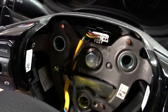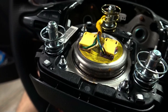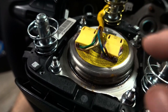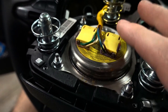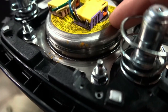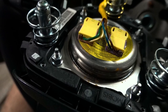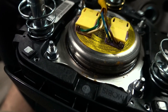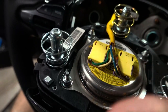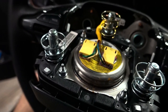On the back side of the airbag it's pretty simple. There's a little horn connector — just pull that straight off — and two airbag connectors that are color coordinated, so no worries about mixing them up. On each connector there's an orange tab on either side. You want to pull those up at the same time using two flathead screwdrivers and then lift them up simultaneously. Once you get those off, you should be free to remove the airbag and gain access to the backside of the steering wheel.